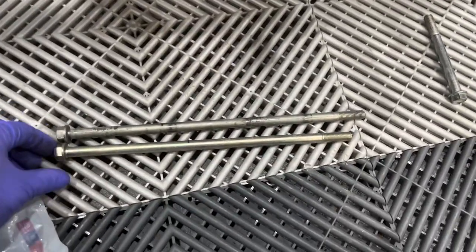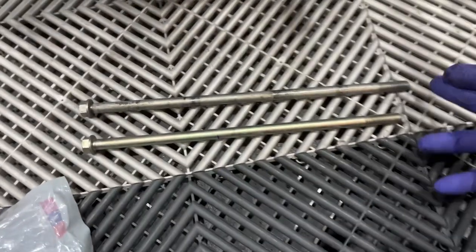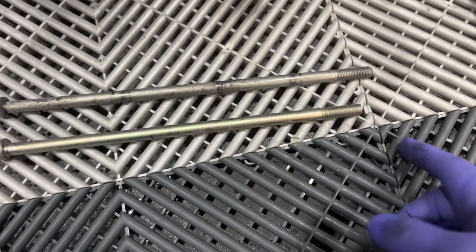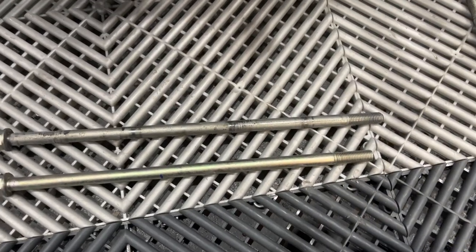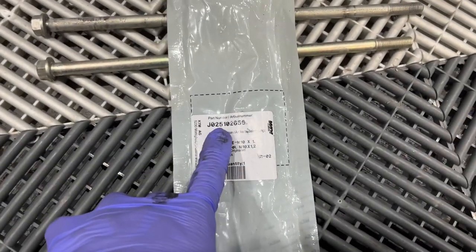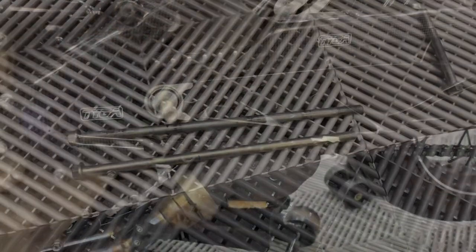Here's the difference between the two bolts: the new one versus the old one. You can see the difference in length. Because of the way the threads are, you can't just cut the threads to make them equal length — you wouldn't have enough thread engagement. The part number is J0251-0265-6, and it's a KTM part.